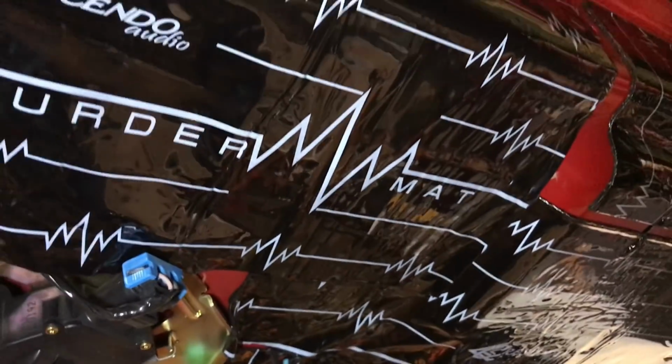All right, ladies and gentlemen, so I got my hatch done, and it was a pain in the ass, let me tell you. I don't have 100% coverage, but I got pretty decent coverage, which should dampen a lot of the vibration. And I'm pretty satisfied overall, but it was a lot harder than I thought it was gonna be, in all honesty. This stuff wasn't bad, but on the inside of the frame there, getting the outer skin of the sheet metal, that was tough because my arms wouldn't even fit in there and I had to bend in very awkward positions.